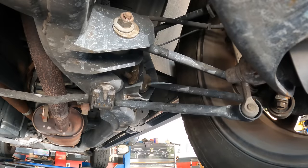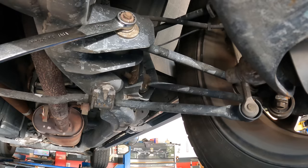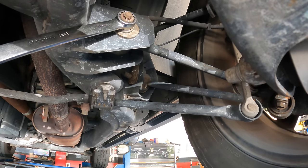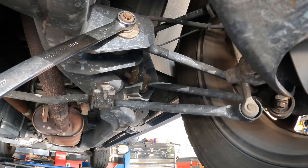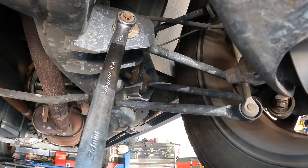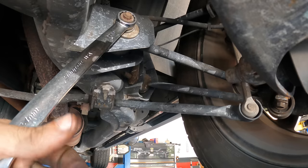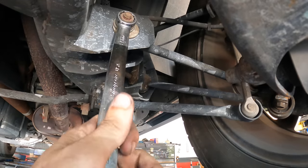We're here at the right rear tire, and the measurement for this right rear is positive 0.31 degrees, so it's pointed towards the center line of the vehicle, almost 1/3 of 1 degree. That may not sound like a lot, but at highway speeds, that little bit of tracking not being accurate can have a very drastic effect on the vehicle's handling.